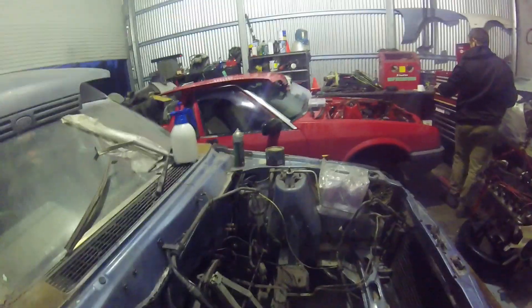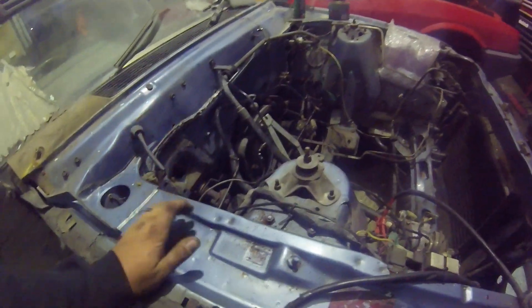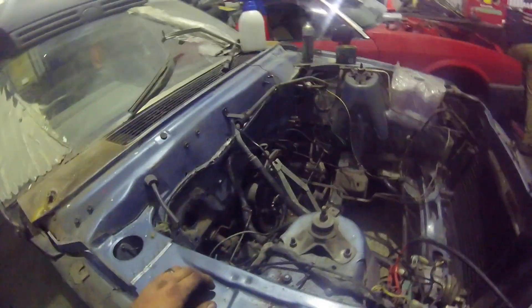It's a lot of swapping and changing but once it's done it'll be good. We're going from the electronic dizzy to the two-wire basic XE-style dizzy. Remember this is an '84 XF engine — old, pre-emissions, pre-cat-converter. We've got a good radiator too, pulled that out today. Once we finish pulling stuff off the engine I'm going to push it outside, give it a massive clean — nobody wants to work in a dirty engine bay — pull some more stuff out and then paint the engine bay. I'll endeavour to film as much of that as I get time to. Thanks for watching.